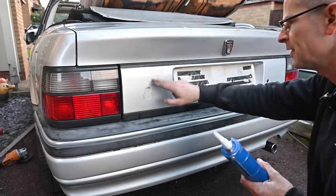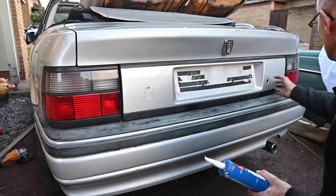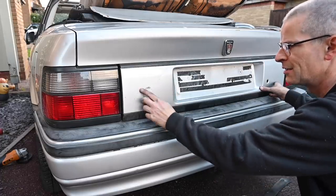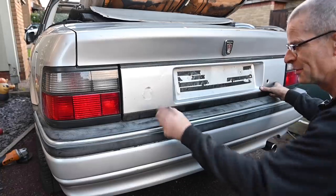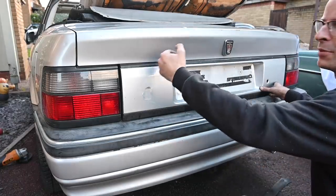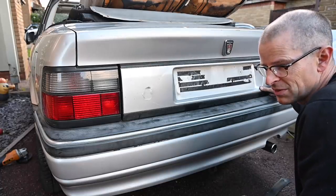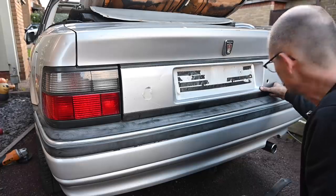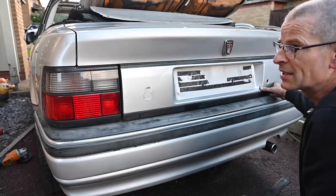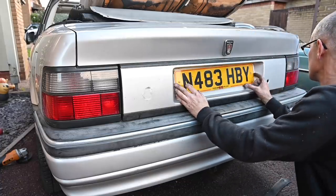I've just used a bunch of Sikaflex 252 to fill in the black broken mounting points that bolt through to the other side of the boot lid, so that this will bond on to the panel. Behind this panel, there are four or six black plastic mushrooms, the fat end glued to the plastic bit - they go through bolts through the metal. Our friend up north in Manchester has actually got one of these in the correct colour that I can have. We were going to exchange it at a Rover event that didn't actually happen because of lockdown. So I'll repair this for the time being, and when the time comes we can meet up and exchange that part. These aren't the original number plates - I don't really like the red line around them, so I think I'll get some nice new ones made up.